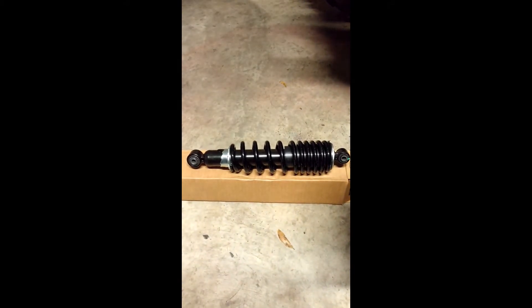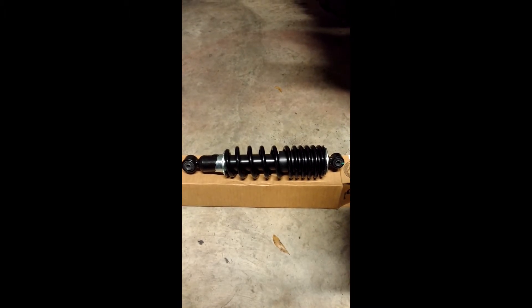So today I'm going to go ahead and swap out to the 17-18 shocks. They weren't bad — I got two brand new ones off Partzilla for about $120 shipped. Much cheaper than a Walker Evans or an air shock upgrade, and they just bolt right in. It's just a 14mm bolt at the bottom and another 14mm at the top.